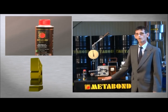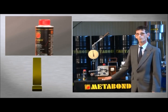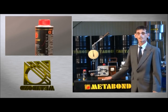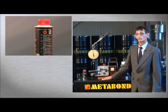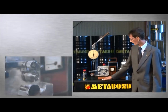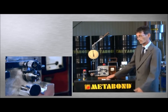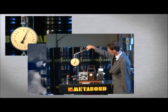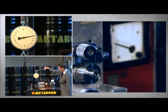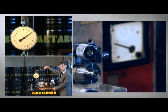Cold start is an extreme operating condition in the case of vehicles. Based on car factory measurements, we can state that a cold start equals abrasion in hot operation over 100 to 150 km, which means that if the car engine is started on 1,000 occasions, the abrasion value of the parts is at least 100,000 km, which is naturally not indicated on the speedometer. I can show you a broken oil pan where lubrication by oil flow did not take place at all. With normal lubrication, our machine was already damaged after 5 units — now we can see that it operates silently and well.